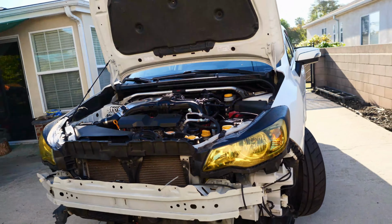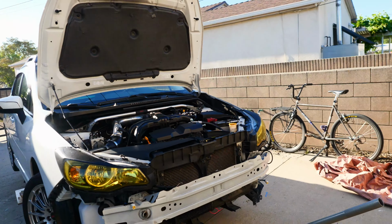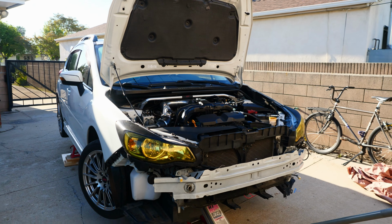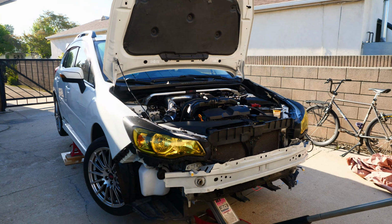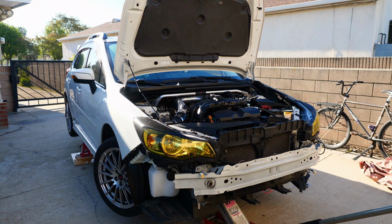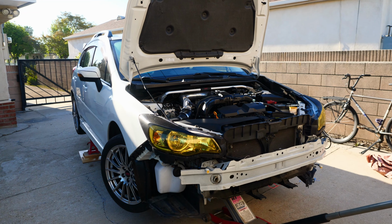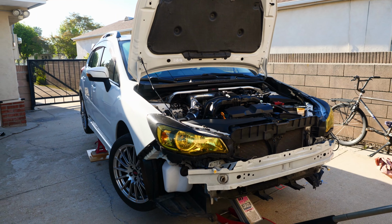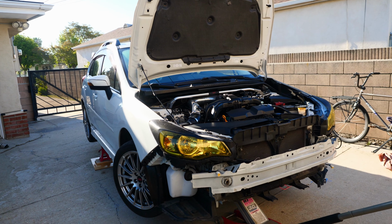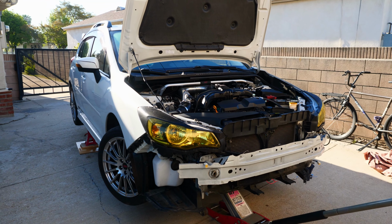The one that I felt was, idle was fine, top end was fine, but revving through the mid-range, I could feel it totally lacking power. When I start the car, sometimes I also heard a little bit of rattling. I thought it was just exhaust shields, but nope, it was the element inside of the catalytic converter that has broken loose. You don't want to be driving around like that for too long because your car could overheat, or you don't produce power, things like that.